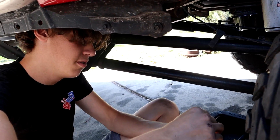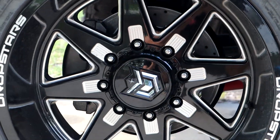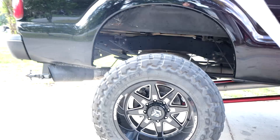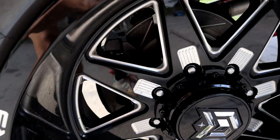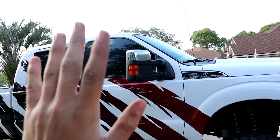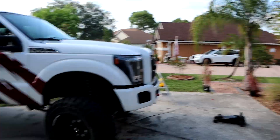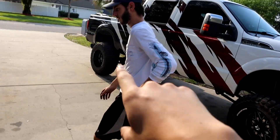Alright guys — we got all the wheels back on, which means all the brakes are back on. They look so much better — they look small still because he's on 20s, but they look a lot better than the rusted ones. These are drilled and slotted; the calipers and rotors look a lot better, it's a whole lot cleaner. One problem though — we bled the brakes and when we test drive it the pedal has a lot of mush where nothing happens for a while, then it brakes really late. That means there's air in the lines. We have to come back and bleed them again tomorrow. We did the two back rotors and calipers today and bled them once already.